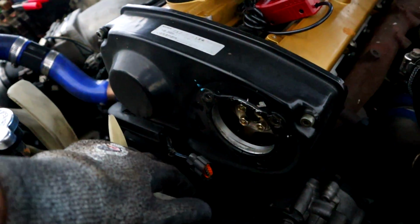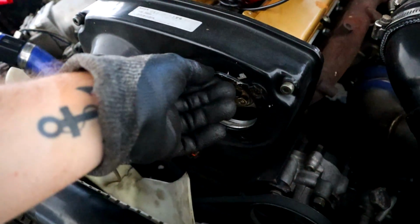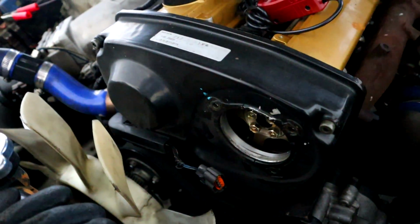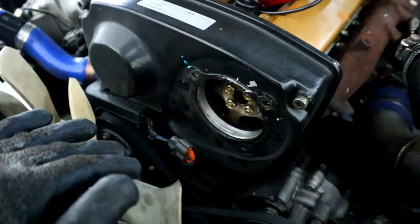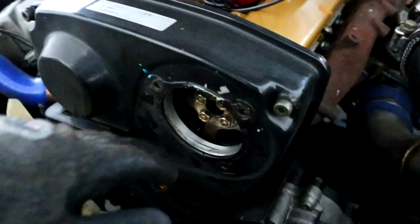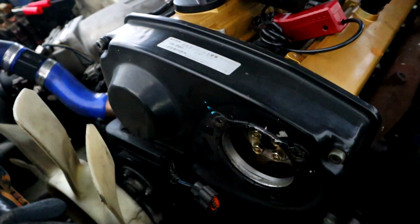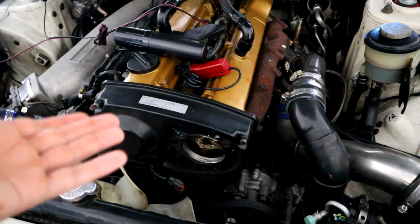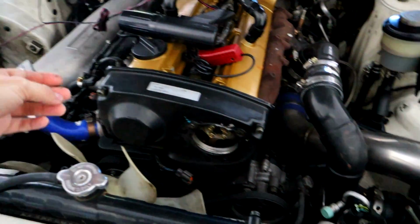well. You would have to take off the fans, the balancer, everything, to try and fish out all these little pieces of plastic. So just make sure, I'm probably gonna take my gloves off for this, but you're just scraping all this off perfectly. And yes, do not drop it down your timing cover. I'm probably gonna put a piece of scrunched up paper or a microfiber or something on the lines just down there, just to make sure nothing goes down there. Or it may even be safer literally just to do everything with the cover off. It's only a couple of screws, so I'm probably gonna do it that way.